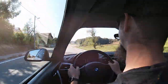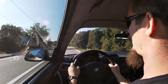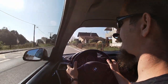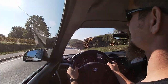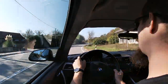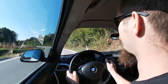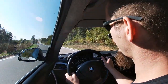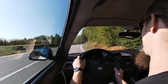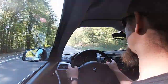Would I do everything the same? No, I wouldn't. Even though I love the brakes, I would probably go with a slightly smaller 3-series setup: 312mm in the front, 300mm in the back, single-piston calipers, and I could get that done for around 500 euro. The rest I would spend on either some cheaper coilovers or Bilstein B8 or B6 combined with H&R springs. The suspension is pretty comfortable and predictable, but it's not perfect — the shock absorbers aren't really up to the job right now. They are the weakest part of the car.